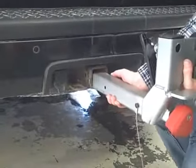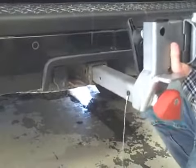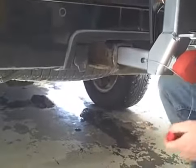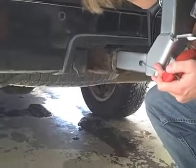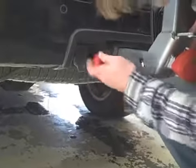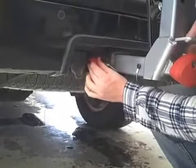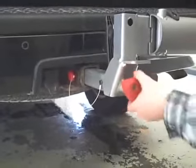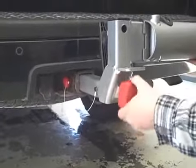The Swing Daddy box contains two pieces that need to be attached: the tongue or swing arm extension and the upright portion of the carrier. The easiest way to attach the two halves is by first installing the extension. Slide the tongue into your 2-inch hitch receiver until the pinhole in the tongue lines up with the pinhole in your receiver, and slide the red safety pin through both holes.